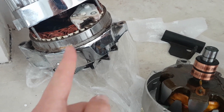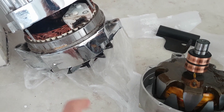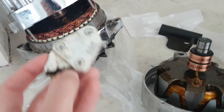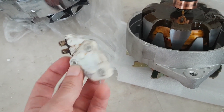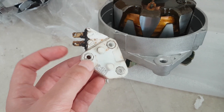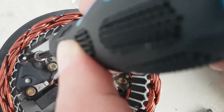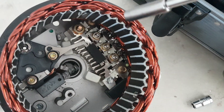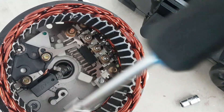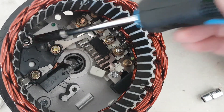This is a 12SI and this is a 12SI as well, I believe. I've already taken this one apart — it was fine but the bearing was noisy, so I've taken the voltage regulator out; it's just this piece here. I'm not sure if this one is self-exciting or if it requires to be plugged in to these two terminals, so we'll find out. This one is self-exciting. Right now I'm taking out the three screws — it was a bit difficult to get to because you don't have direct access downwards and you actually have to undo these three and then take the magnet section out, but I wanted to cause minimal disruption so I'm just using the spanner. These are quarter-inch.